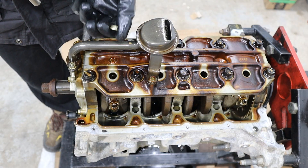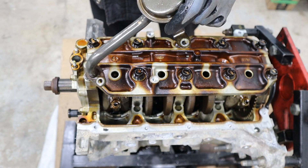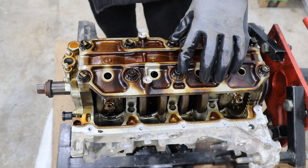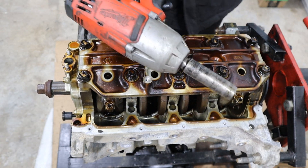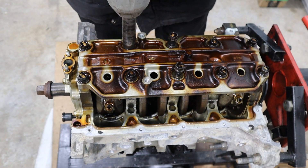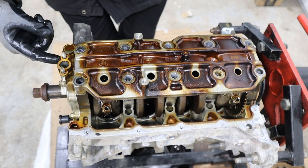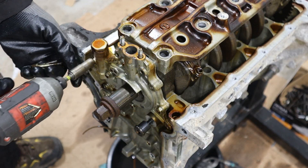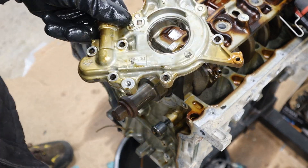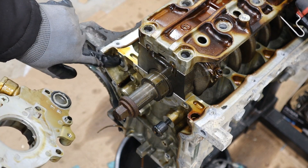A very simple piece and there are no crumbs or anything inside of there. The bottom end has a ladder frame design as opposed to having separate bearings, using 14mm bolts. We've got two bolts going into the oil pump here — might as well take out the whole oil pump first. Popping off the oil pump — it's a very simple direct drive oil pump. Oil comes in from the pickup tube and exits directly into the block. This is likely a gear style oil pump.